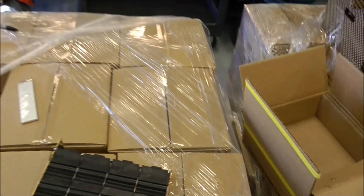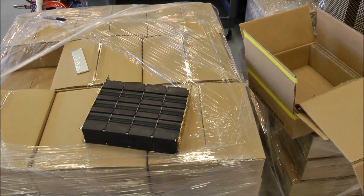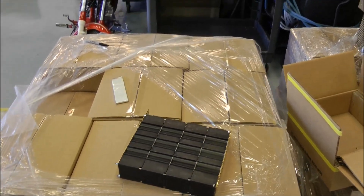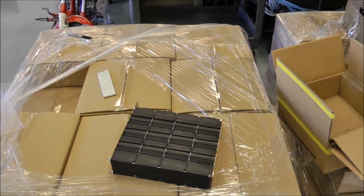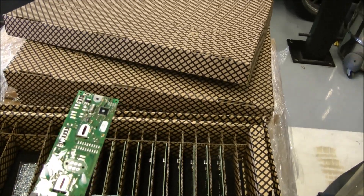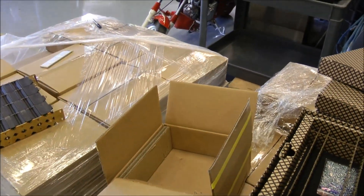We have 56 of these modules that we're going to install in the car. This pack will be much larger, so it's going to stay not just in the trunk, but it's going to have to be extended into the back cargo area. We may even put some of the cells up in the front for better load balancing and weight distribution. Each of these individual modules gets their own BMS boards, doing some load balancing at the individual module level, and then there's a more sophisticated BMS to connect the whole system together.